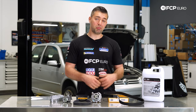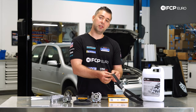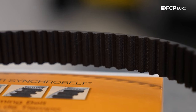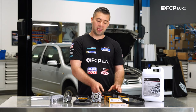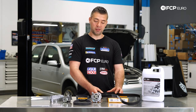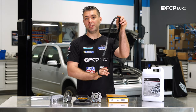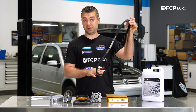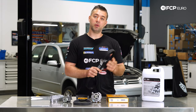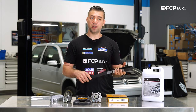There is an inspection cover, but you should probably check it more frequently. You could peel back that cover and just look at the condition of the belt — whether it's cracking, fraying, or if it's glazed over. This is something you want to keep fresh. If the belt fails, it will lead to catastrophic engine damage. Basically what this belt does is it links the top half of the engine to the bottom half and keeps everything in sync or timed properly — hence the name timing belt. When this snaps, you could get valve to piston contact. So definitely something you want to keep on top of and replace regularly.